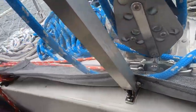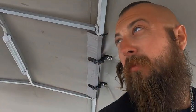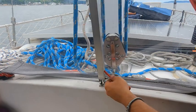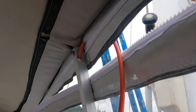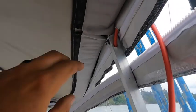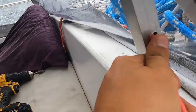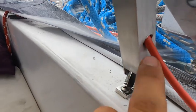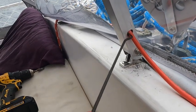Right before we go in that gives you a nice little clean transition — a little backyard redneck fab trick for anyone out there trying to do this. This is just one of the supports I added for the Bimini, not actually really structural, just adds a little help when you put a shitload of panels on it. The camera died while I was drilling this hole, but this is what I got so far. My plan to do a nice little hole here has kind of failed. When they say they don't build them like they used to — this boat is slow as hell but it's tough as hell. The glass, the decks, especially this aft cabin, is super thick — almost an inch of core wood with glass layers on both sides. I was almost a full drill bit depth to get through to the other side.